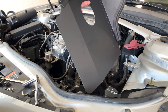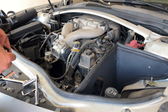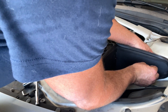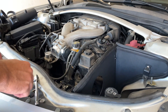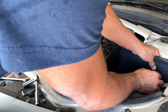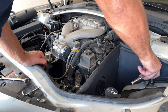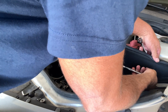Once you've done that, go ahead and install your heat shield. Slide it down in — it's going to be a snug fit, so get it down in there good and snug. Once you get that, you'll need the supplied bracket as well as the 10-millimeter bolt, one washer for the bolt side and one for the nut side. Hand-tighten the nut first to make sure you have enough wiggle room to attach it to the original bolt location. Both fasteners are 10-millimeter, so you'll need your 10-millimeter deep socket and your 10-millimeter wrench. Once hand-tightened, come back and tighten everything down.